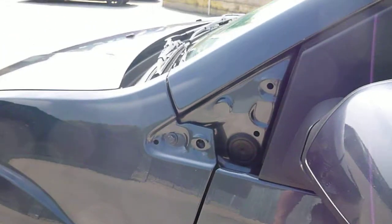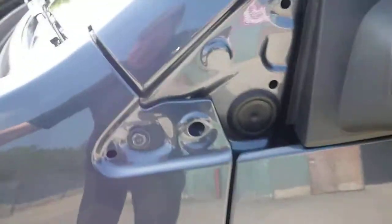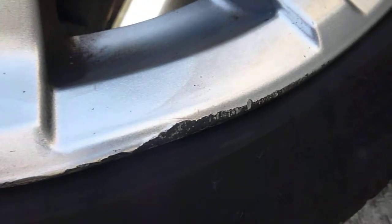Looking down the car I can't really see any dents or any scratches. Mirror glass is fine, door mirror casing is fine. There is a trim missing just on the front of the mirror casing there — it's just a bit of plastic so I can't see it being that expensive. Near side front tyre is on 4 to 5 mil tread. Some light scuffing on the alloy wheel and again there is a tiny bend just in the alloy there.